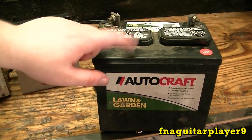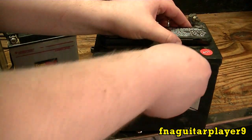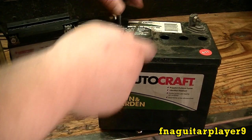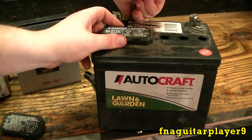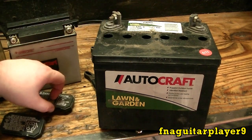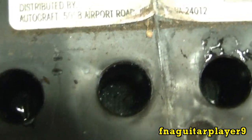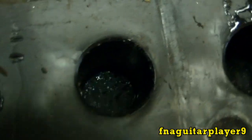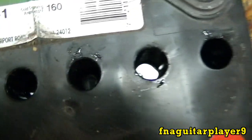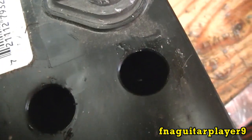If you've got this type of battery you've got to pop the caps off to get to them. I like the other type better for checking them. Be sure to always wear safety glasses when you pop them off because you can sling acid. They look pretty high. If you look, you can actually see all the plates in there — it actually looks a little dirty in there, but not too bad. I'm gonna leave this one alone. Actually, the two on the end look a little low so I might put a little bit in them.